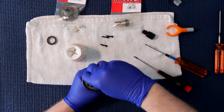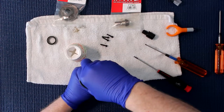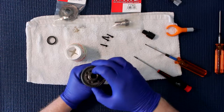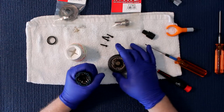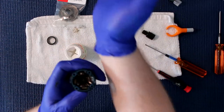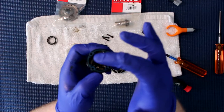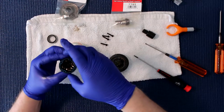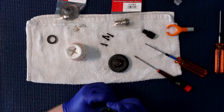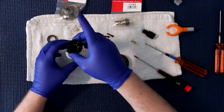Now we have our last screw — put it aside. I'm going to hold the bottom and slowly wiggle the top loose. I don't want to wiggle it too much, for the simple reason that there is a gasket here. You see the gasket right here. Oil-wise inside — it did lose a little bit, but it will be okay.